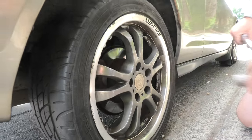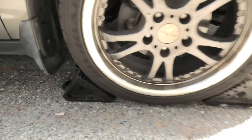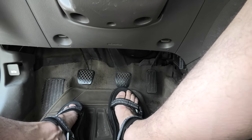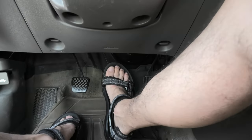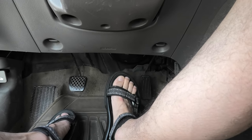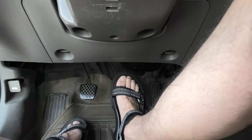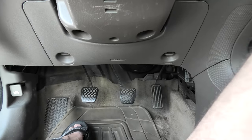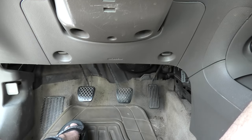And it's done! After you have installed the wheels, there is one more important step before you can remove the wheel blocks. You need to press or pump the brake pedal a few times. It's going to be soft the first couple of times until you start feeling that the brake pedal is firm again. This will ensure proper braking and you won't have an issue once you start driving. So always press the brake pedal a few times after you have replaced your brake pads.